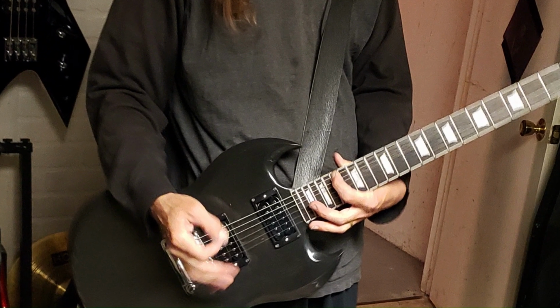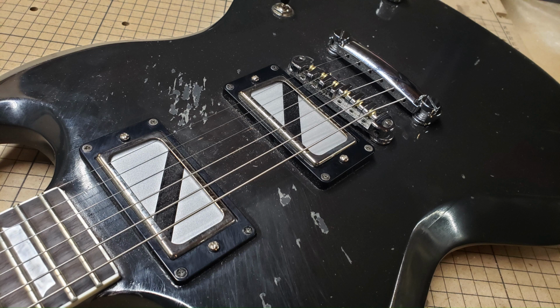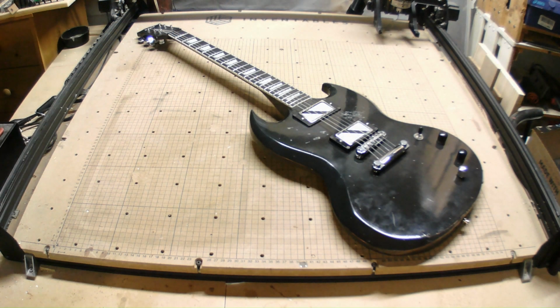First, it needs a clear coat. This was a rattle can clear, and it is failing hard. Thanks to Super Tim, I now have a paint gun and a real clear coat. So this needs to be sanded down, touched up with the transparent black, and re-cleared correctly.